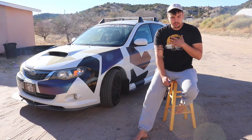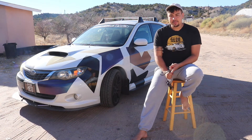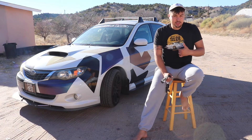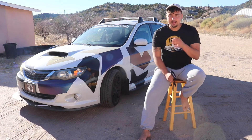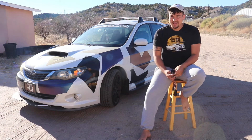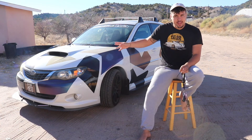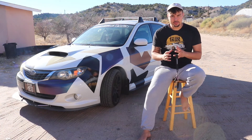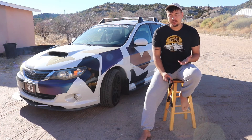Besides that, all the work I've done to this car has been done by myself. Some things include the cold air intake — particularly I have the Typhoon K&N. I personally like it a lot. It's not necessarily the short ram; I don't like the Cobb short rams. Everyone I know that has them says their intake temps are super high and they just didn't get good gains. The K&N has a super huge filter and it actually goes kind of into the wheel well, which is nice to get some cooler air that's not as restricted by heat from the engine like you'd get on the short ram.